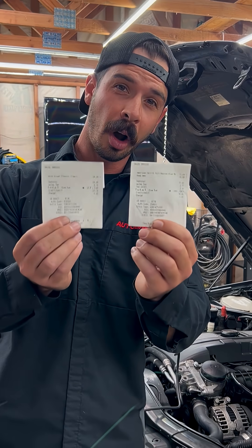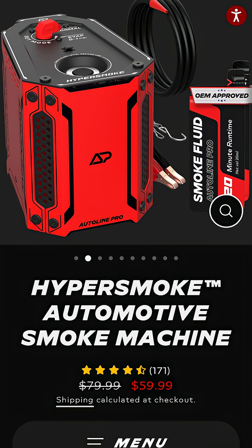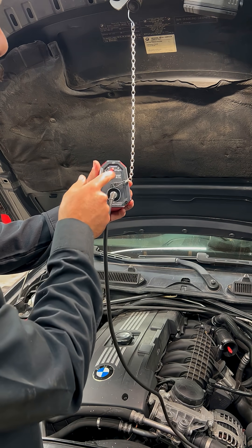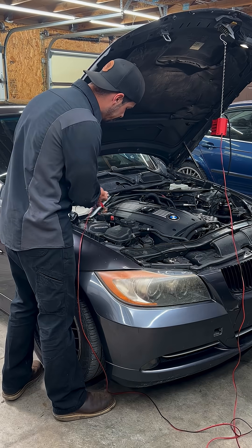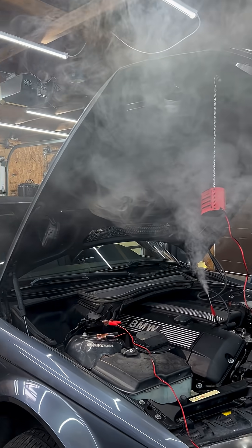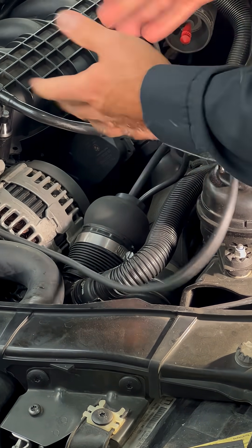I spent $64.08 for the cigarettes, cigars, and the vape. And for less than that, you can buy the HyperSmoke Diagnostic Smoke Machine. It's got a built-in compressor and two pressure modes: 0 to 7 psi for normal and 0 to 1 psi for evap systems. All you have to do is connect it up to your battery post, and in less than 30 seconds this thing is producing smoke. Just connect it to your adapter, let it build up a little pressure, and find your leak.